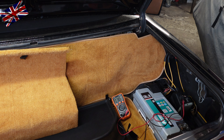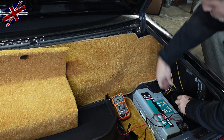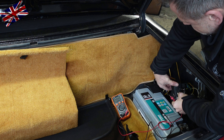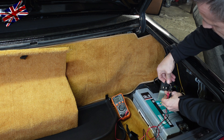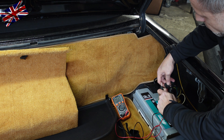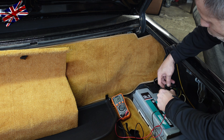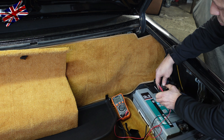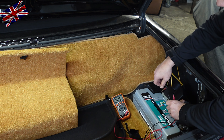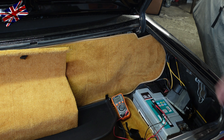Before checking the yellow vacuum lines, let's start easy with a multimeter and see if the pump is getting current at all. First step: pull the connector wires from the socket of the pump at the smaller end — this socket with two pins — and connect the multimeter. We need some 12 volts, at least 10 volts for the pump. If you have an anti-theft system installed, the connector must be disabled first. Disconnect the immobilizer connector behind the glove box, otherwise there will be no current for the pump.